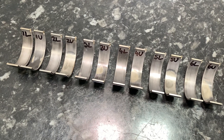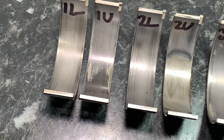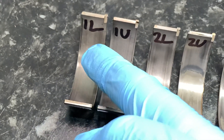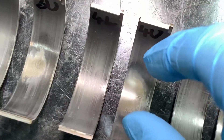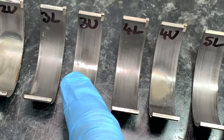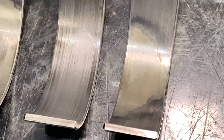These bearings haven't had the entire 108,000 miles of wear on them, but they are showing a little bit of wear — certainly not horrific, but clearly something is going on. If you take a lower one, it's very uniform in its colour, quite grey, with rotational or striation lines on it — that's to be expected and it's not far off what it looked like when it first went in. Then you've got what I'd call a stage one of wear: this olive-green patch here is lead which has been exposed where the grey material has worn away.